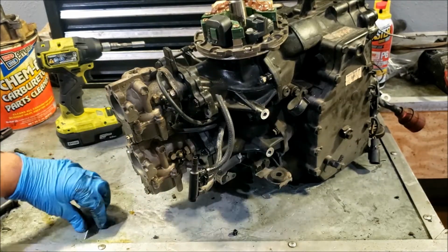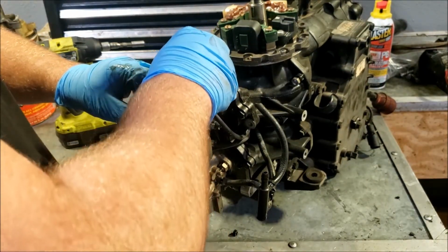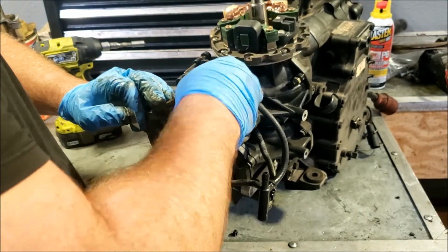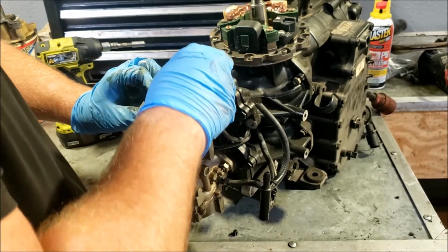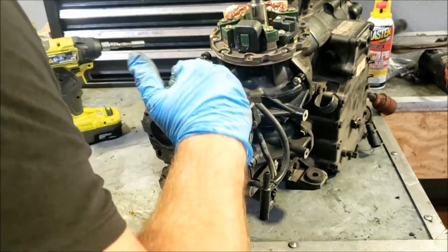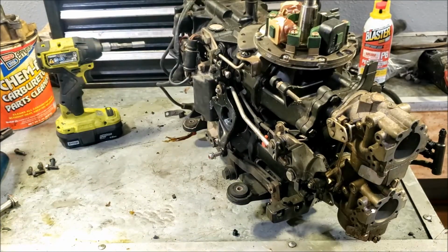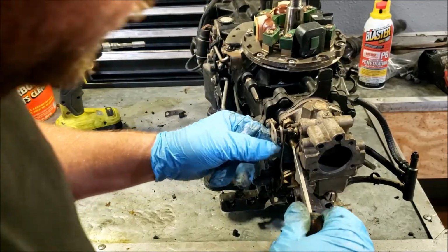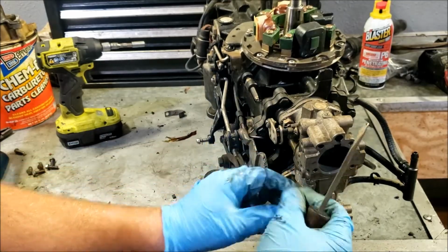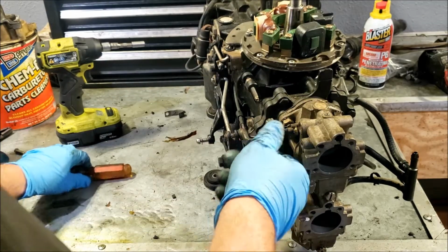So the top carburetor line is already cut. I'm going to slice the primer line up top. These are usually also brass. They're a little stronger, but you still want to slice the hose. That fitting is slightly bent down. We'll make sure that it's clear, but it's still notable that they're fragile. Let's pop off the clip here. On this model, the bends are at the bottom, so keep that in mind.